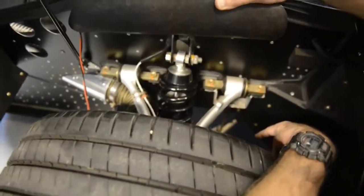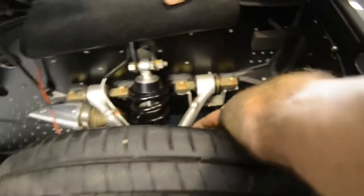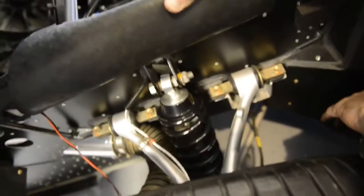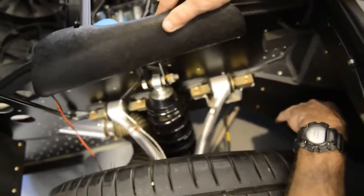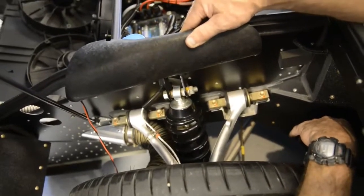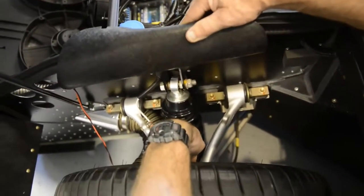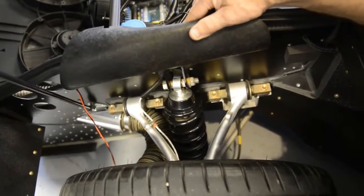The shocks are beautiful. They're easily adjustable — there's a little collar with Allen set screws; you just loosen those up, spin the shock, and adjust your ride height. That must make positioning your body way easier. Oh yeah — if you had to cut and grind your springs every time you wanted to change, that would be awful. I did a four-wheel alignment in the garage — for caster, I ran a straight edge through here and shot it with a laser from outside to determine the angle.